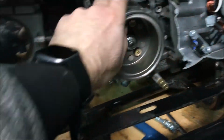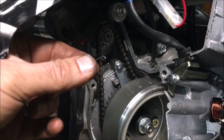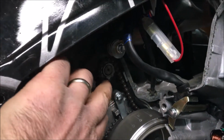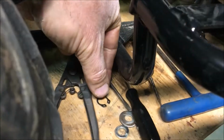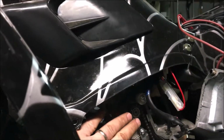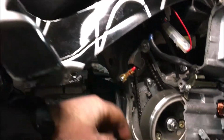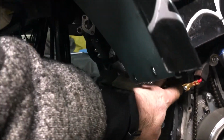So weird. So we take off the retaining clip. So now this could slide in and out. This is just the sprocket here on the starter side. Okay, put everything all together over there. So now when we take off the starter, it can just slide out. Obviously we disconnected the power lead. I think, is there a ground for that? No, it's probably grounded through the frame.